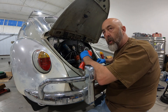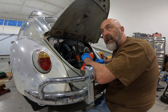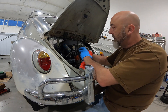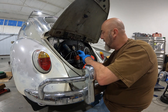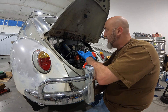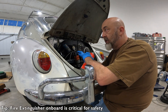I do not care to have it underneath because I like to make sure my fuel is clean. I also make it a point every year and a half — no more than two years — replacing these German woven fuel lines, because they crack. What happens is they'll start seeping fuel underneath, and these will wick the fuel into them. Again, with the right amount of spark and right amount of air, you've got a potential for fire.